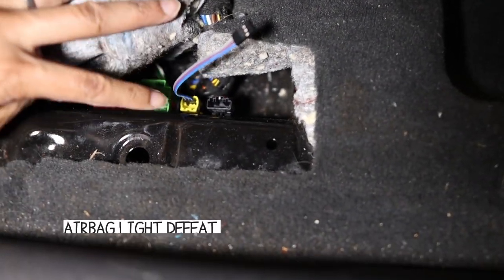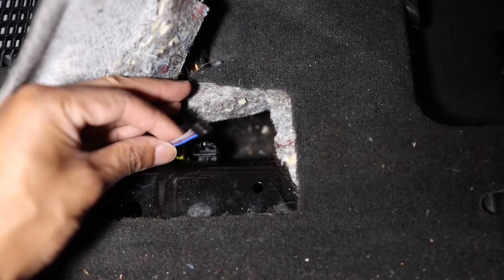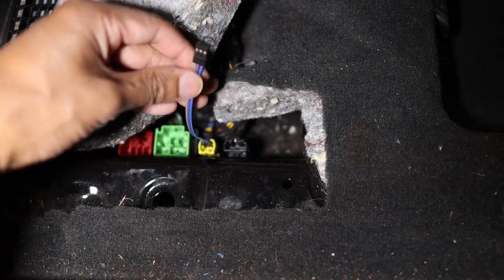The process is different if you're replacing both the driver's and passenger's seats. In that case, you'll not only need a jumper on the driver's side, but you'll also need to deal with the occupancy sensor on the passenger seat. That requires ripping up the seat and removing the occupancy sensor — a flat pad that activates when weight is on it. Most people find a seat with a very similar part number that works with the vehicle. I'll link that process in a future video. Here's an example of the jumper cable in place — I'll link the resistor type in the description; it's a 3.3 ohm resistor.